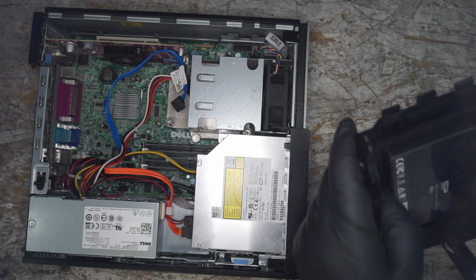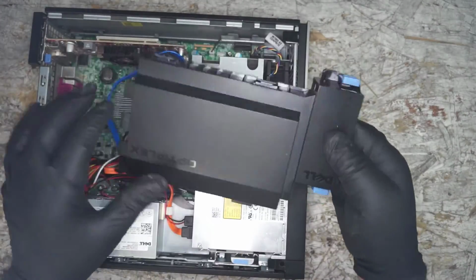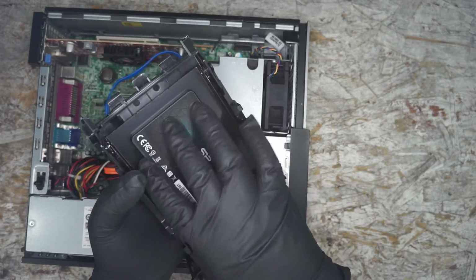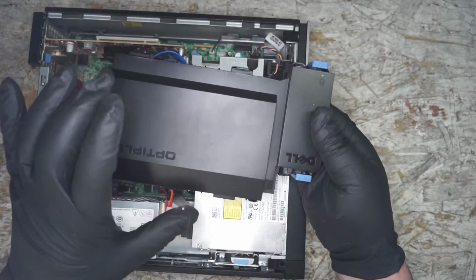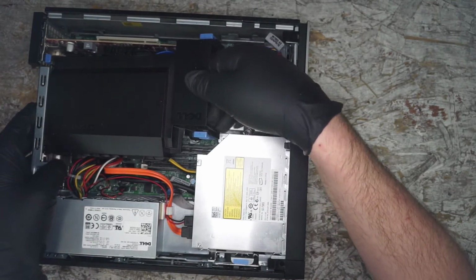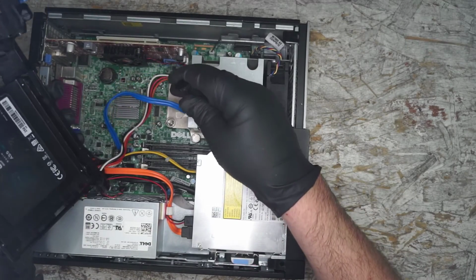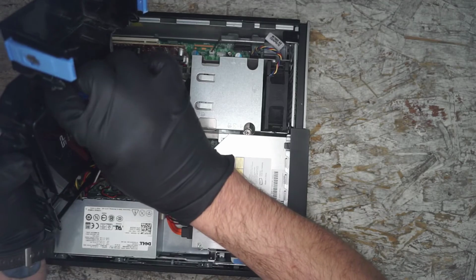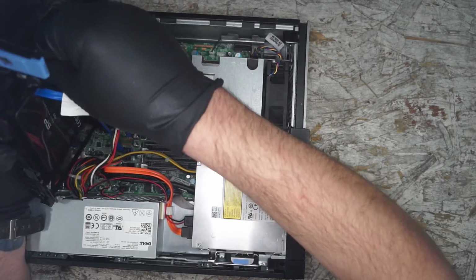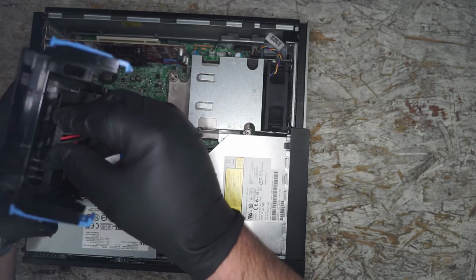Oh, shoot. Alright, getting our SSD ready to go. It's in the stock. We have a 2.5 inch to 3.5 inch adapter plate to go to the 3.5 inch Optiplex branded, funny enough, hard drive caddy. Let's plug in our SATA cable, SATA data, SATA power, and throw this thing back together. Everything else should be good. Yeah, this is the one that did get cleaned out.